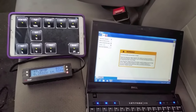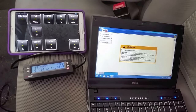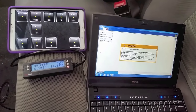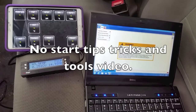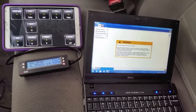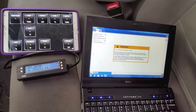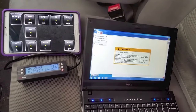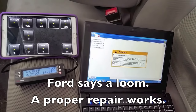Make sure your crank is good, your RPM is reading, and your gauges are all good. If you truly know the problem is wiring, get out there and wiggle the wire — I'll show where it's at in a second — and see if sync comes back. That confirms the wiring is bad. I've had guys go six months, then get to a gas station and call me with a no-start again after turning a corner.